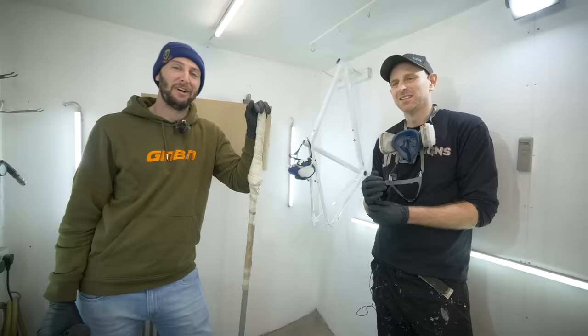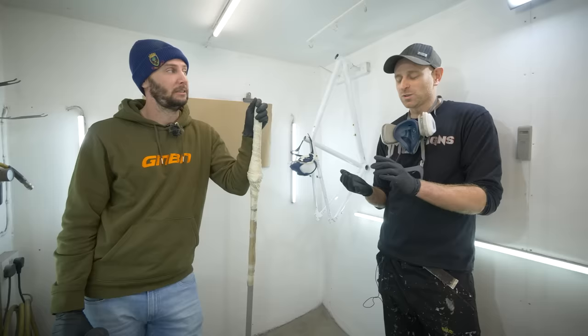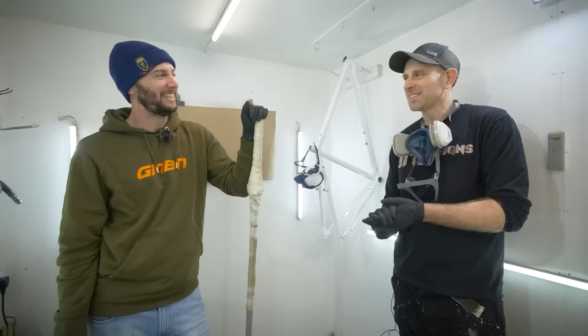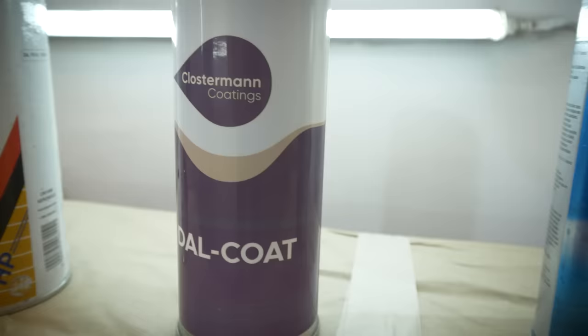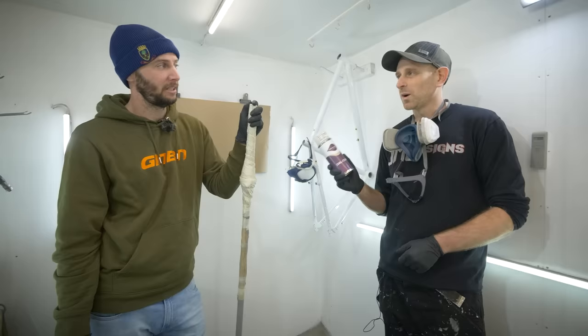All right Paul, it's nearly time to start painting — she's hung up, ready to get a bit of experimenting on it. What's the best type of paint I should use? Well, there are loads of different rattle cans. The main thing is make sure you're using one suitable for what you're painting — always read the instructions. Starting with a bare frame, you're going to go for primer first — that'll etch and bite into your surface, prepare it for the base coat. The base coat is your color. It's a solvent base coat, so you want to be wearing a mask. On its own it won't last — this will come off if you don't use a clear coat.